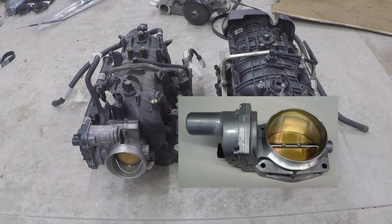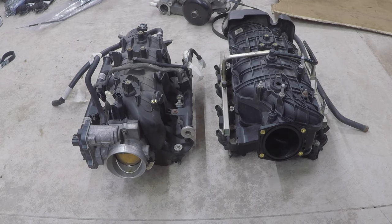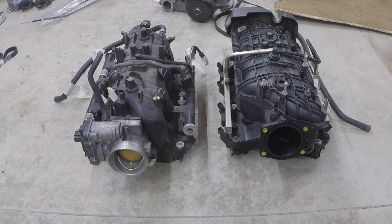To maximize power you can swap to an LS3 or LS2 90mm throttle body. If you do the throttle body swap, you'll need an X-link harness depending on whether you have a gold-blade or silver-blade throttle body. The X-link does not work on many eBay knockoff throttle bodies. It is an 8-pin to 6-pin conversion that allows the signals from the new-school throttle body to cooperate with your old truck harness.